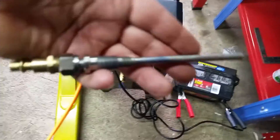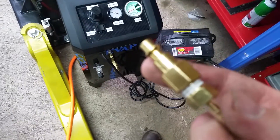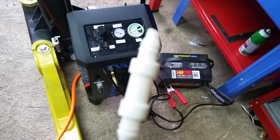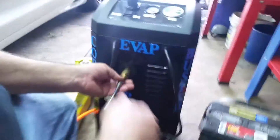What's nice about this unit is it's very versatile — you can use standardized connectors for an air hose and make different connectors cheaply. This one here is connected to a gas cap. Here's another one I made that uses a standard 39-cent hose fitting from Harbor Freight — about two bucks — going from one-eighth to three-eighths for larger lines like gas lines. We're going to use the straight connector, click it into place, and the system is ready to operate.